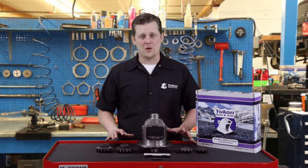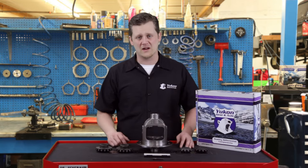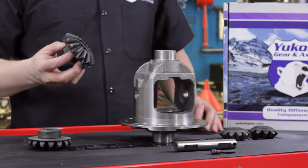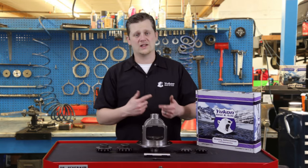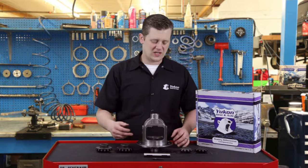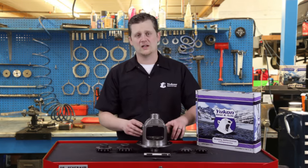When you're starting this out, you really need to know what you're dealing with. Spider gears is just kind of a blanket statement for what these parts are. The side gears, or the axle gears, or sometimes planetary gears, are literally the ones that go on the side. The spider gears, or the satellite gears, go inside next to them and they rotate around them, kind of like a satellite around the planet, hence the names. The cross pin shaft goes through and holds the spider gears in place, and the little retaining bolt holds that cross pin shaft.